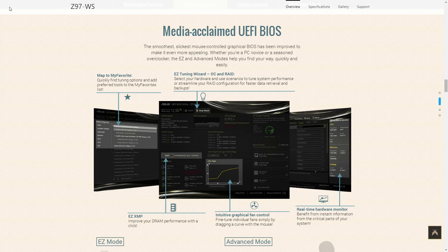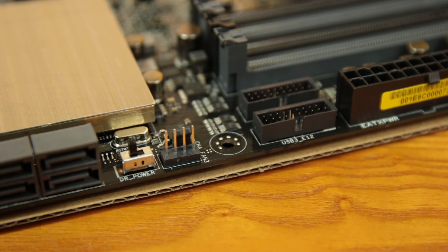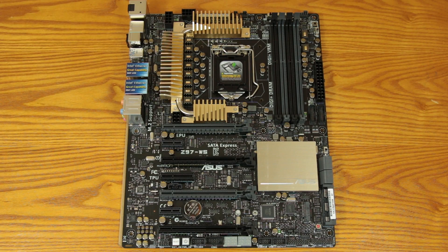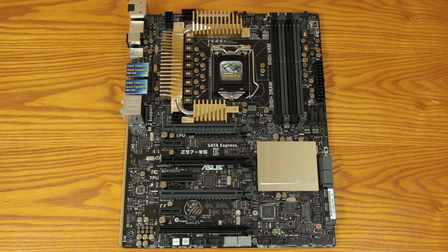The I/O control on this board is quite advanced. You have four 4-pin PWM connectors plus two additional CPU fan headers, and you can set fan curves in the UEFI. If you put a splitter on a PWM fan header, you can control multiple fans while retaining tight customizability on your PWM settings. You can take fans down to extremely low RPM — for example a Noctua fan — even lower than most fan controller software would normally allow, keeping things quiet while still moving some air.